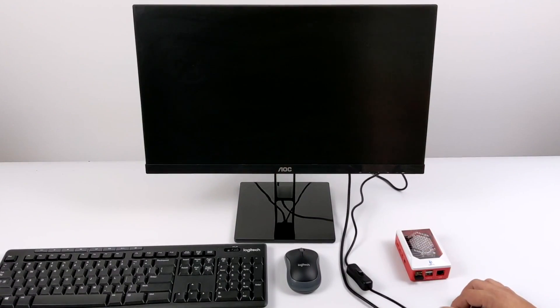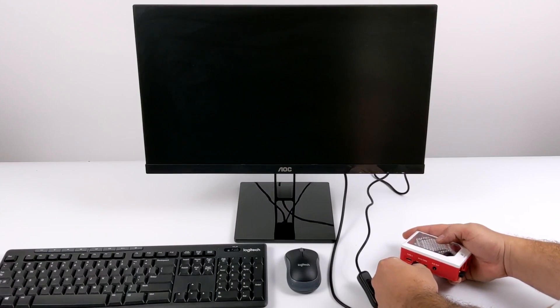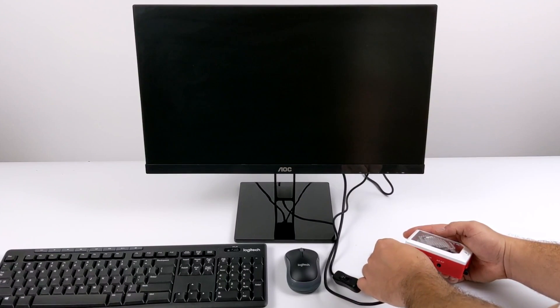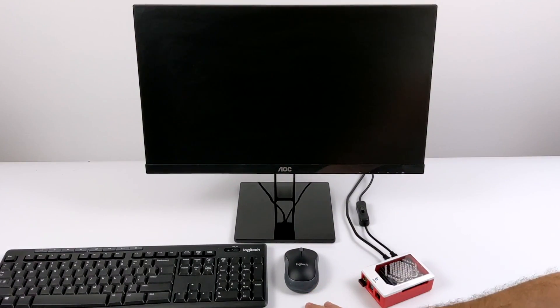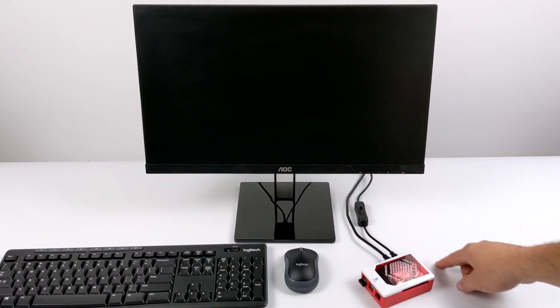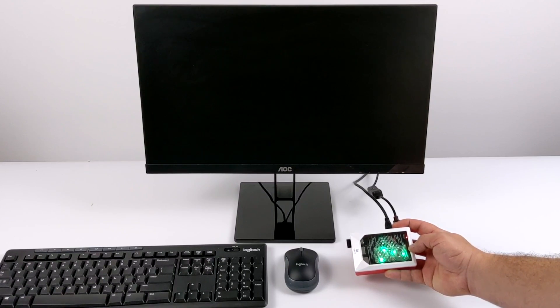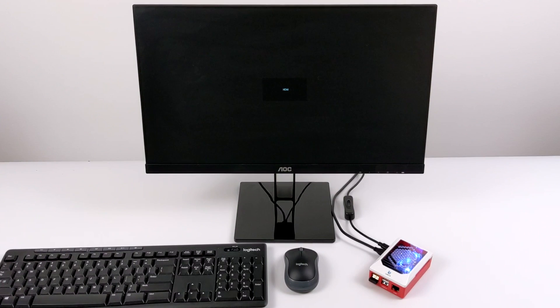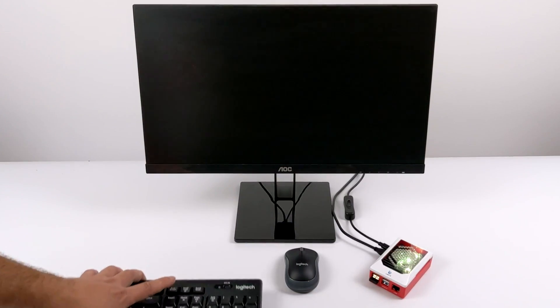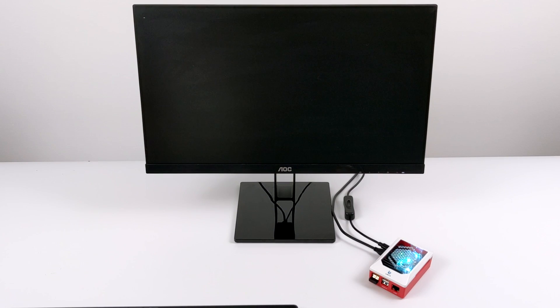I've got my keyboard, mouse, and monitor set up. Plug in the HDMI — if you're using a single monitor with the Raspberry Pi 4, plug the HDMI into the one closest to the USB Type-C. Also plug in the power, make sure keyboard and everything is plugged in, and turn the switch on. As you can see, these fans have lit up — they're RGB so they'll change color constantly cycling. There's no way to adjust it, but it adds a little more to this case. And by the way, if you want to shut the Raspberry Pi 4 down, don't just hit the button on the power supply — make sure you shut it down through software by going to the start menu and shutting down. Then you can turn the power off. You don't want to corrupt the SD card.